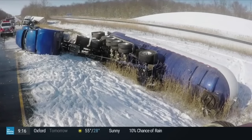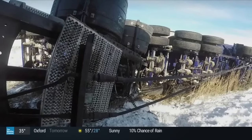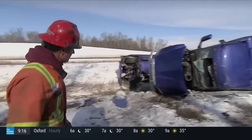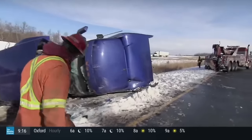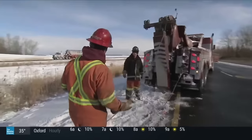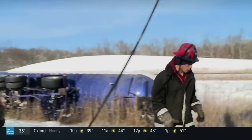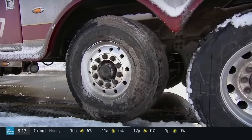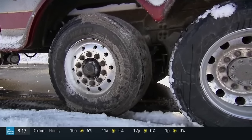Colin's first step: drag the tractor back to release that tension. But he's brand new to this truck. Hey, Col? Yeah? If you drop that third axle on your truck, that puts one more set of wheels on the ground. Get more traction. Okay, yep, I'll do that. The more surface area blocking us, the better.